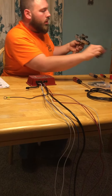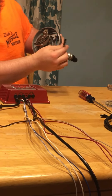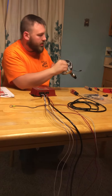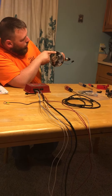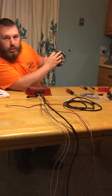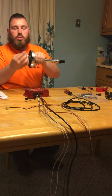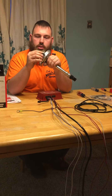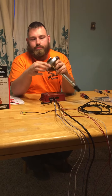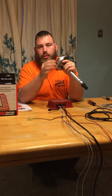What this box is doing is removing your ignition control module via this little wiring harness. There are three screws — here, here, and out to the side where your condenser is. You take those out, add this purple and green wire which connects to the extension I showed you, and unplug the original. Plug the purple wire in with the white wire and the green wire with the green wire. They're two different sized connectors so you can't mix them up. There are plastic clips to mount and hold the wiring so nothing gets into your centrifugal advance, and a rubber grommet that slides in where the original went to protect the wires.